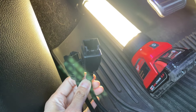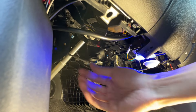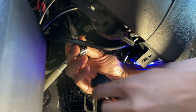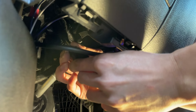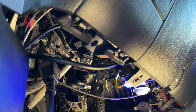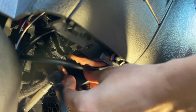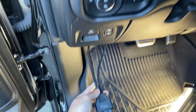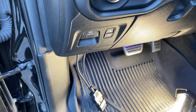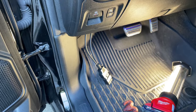Now we're going to plug these two connectors onto our ends right here — they only go in one way. Now that we have the two cables, we're going to plug them into our bypass. You hear that click, you know it's secured. Plug the other one in — it only goes in one way, so don't worry about reversing it. Now that you've made the connection, your setup should look something like this. You don't even have to go under here — you can just put your hand under the dash and make all these connections.